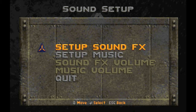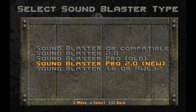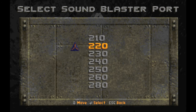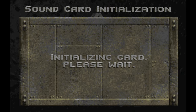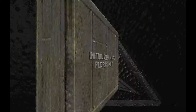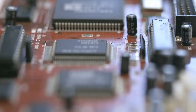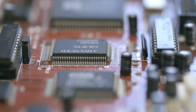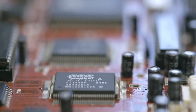This card is a different beast though. For games that are missing Gravis support, you don't need to use some crappy emulator anymore, you can use the Sound Blaster Pro in-game setup directly. And for both, sound effects and FM music. Since the ESS chip is really good in terms of compatibility, sound clarity or FM playback, this card should be one of the best out there. But we'll see about that. Since there are 2 chips on board, GF1 and ESS, I'll have to find out which one produces less noise, and thus which one is more suitable for sound effects playback.